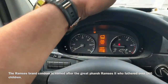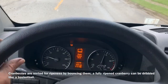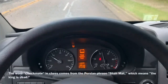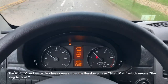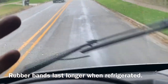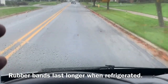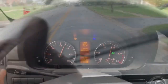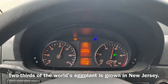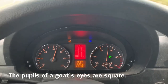I haven't been able to give it any gas yet, but we're going to see what's up. Whoa! It's like a starship! This thing has got power for days. I can definitely hear the turbo spooling — everything's working right. Before, when I would reset the check engine light, I'd have turbo spool for about a second or two and then it would drop into limp mode. That is definitely not the case any longer. We're tooling down the highway at 70 mph and about 2800–2900 RPMs and she's running smooth. No check engine light, no problems. Hope yours turns out the same way as mine.